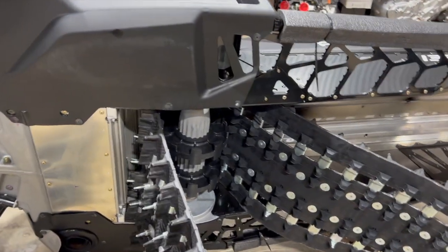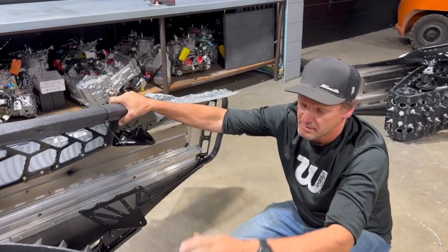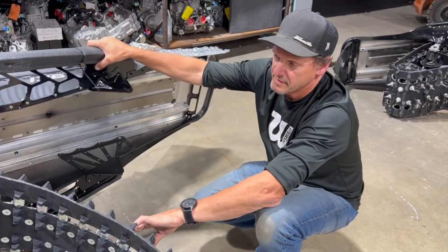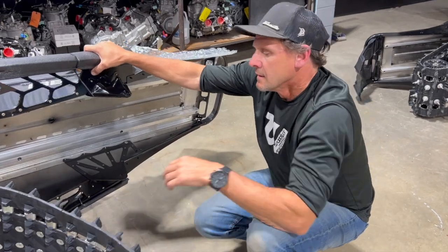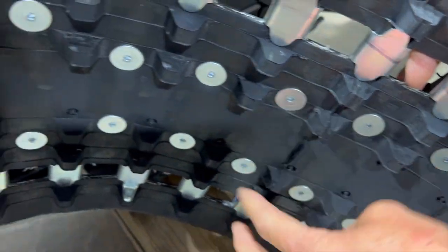You cross a road, and usually that's where the snow's blown off, and then on the other side you're climbing a hill and it's all ice, or you're coming down one to go to the road. So, to me, that little bit of extra 1/8 inch between those two stud lengths is what I would do. When you're pulling them in, you look on the back side, it's just everything's very, very smooth.